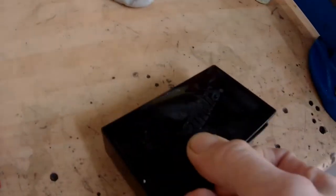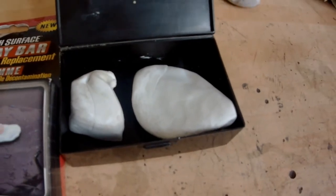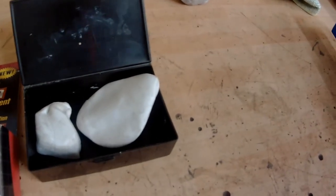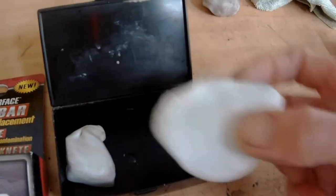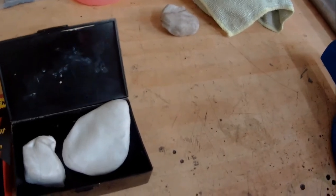So we've got the clay bar here — it's just like a lump of clay. There's a new one and I keep it in a box because you don't want to get dirt, grit, or contaminant in it before using it on the car. There's an old one I've used on other cars but I'll throw that one away — it's quite dirty and I don't know what's in that. So with a brand new clay bar we'll have a before-and-after look at what it picks up from that bonnet. It's pretty easy to do: you spray a lubricant onto the paintwork — you can buy a special lubricant or just use a bit of car shampoo watered down — you just want something so the bar rubs nicely and smoothly over the paint. I'm going to use some Demon Shine spray-on detailer, that tends to work pretty well, and you just buff it off with a microfibre cloth afterwards. Once you've done that you'd apply some wax or polish just to seal and protect it.